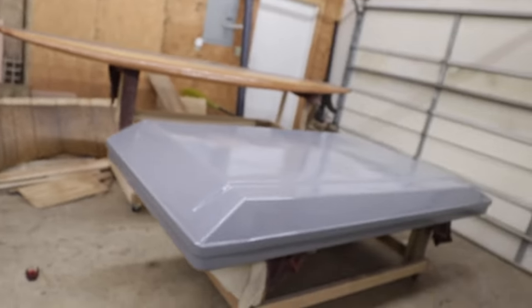All right guys, I've done 5 or 6 coats of our top coat, and I think it's come out really awesome. This paint is so cheap, so forgiving. I did coats that were 1-to-1, I did a coat that was 2-to-1, I did 1-to-1 with the catalyst hardener. I baked it out in the sun for a while, and all the coats turned out really, really good. I did scuff the paint with Scotch-Brite between each coat, but super cheap, super easy. I think it turned out really well. Check it out.